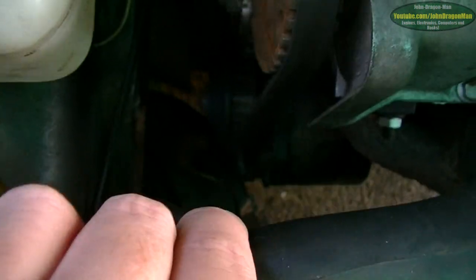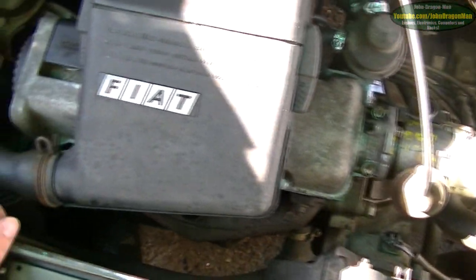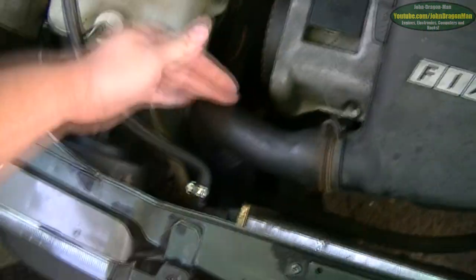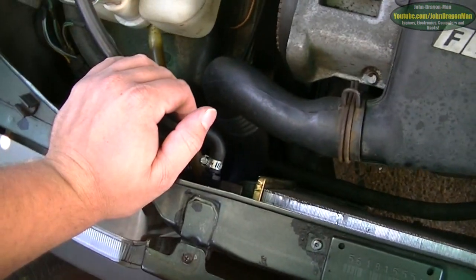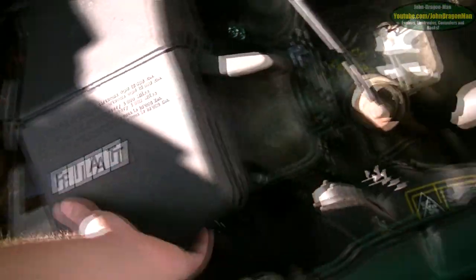The thing in question is there — it makes a funny horrible grating sound. The first thing I need to do is to remove various piping from the airbox, as it will be in the way — probably just remove the airbox completely. Nice and easy to do. You undo that one clip, there's another clip underneath, you undo that one, and the airbox will come out — pull it out of that as well.